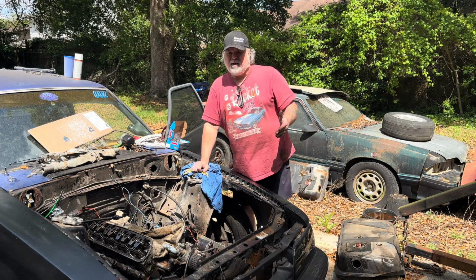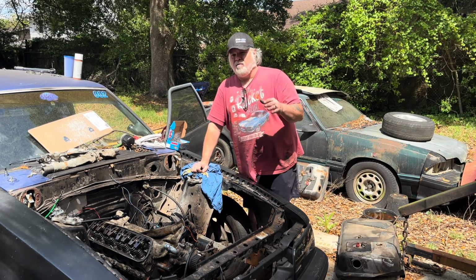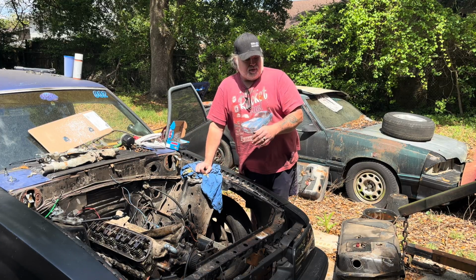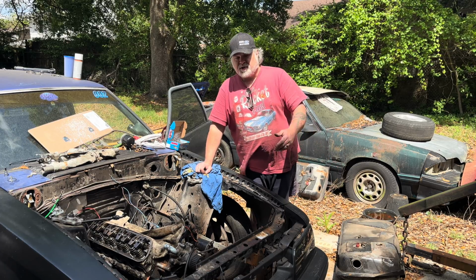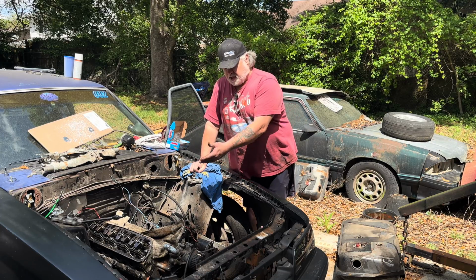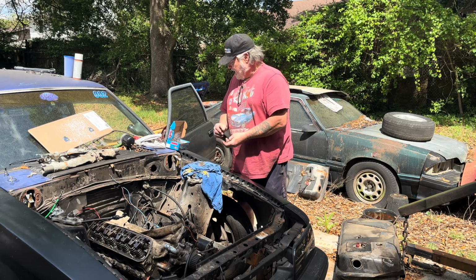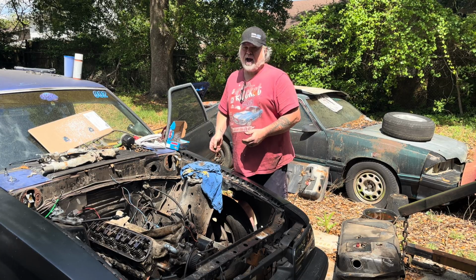But I just wanted you to be aware that if you're looking to buy a set, be aware of what you're buying and what you're getting or not getting. If you buy the set with the bushings, it does not come with regular washers. You would either have to drill the heads out to fit the washers or the reducers, or rustle up some washers. And I get it, some guys like myself could potentially put aluminum heads on. Then I will need these bushings. So that's why they sell the bushing separate as well. But anyway, it's not a big deal. We personally have a workaround, but for the average guy, maybe you don't.